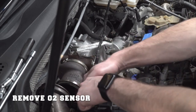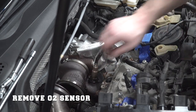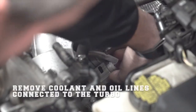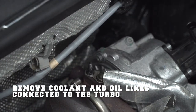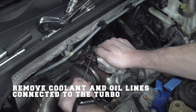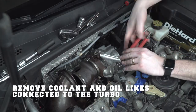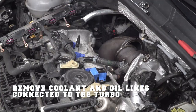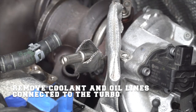Now I'm removing the O2 sensor on top of the turbo — I'm using what I think is a 7/8ths socket, which I found easier than the standard O2 sensor socket for a little more leverage. Now it's time to remove anything else connected to the turbo. I started with the connector on the driver's side, then moved to the oil line on top. Using a screwdriver to pry — just be careful not to bend the retainer flange. Depending on mileage, the O-rings are what's really holding these lines in place; the retainer clip just keeps them from moving.